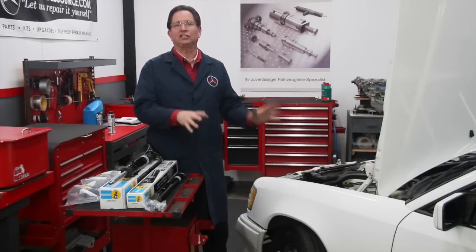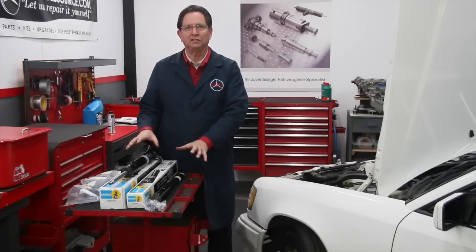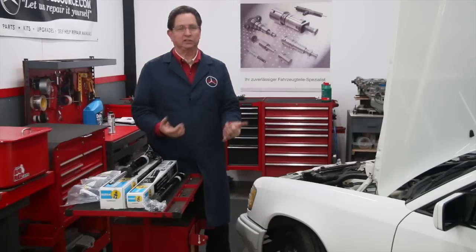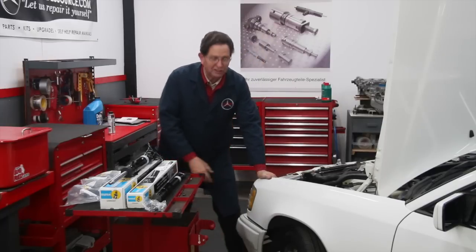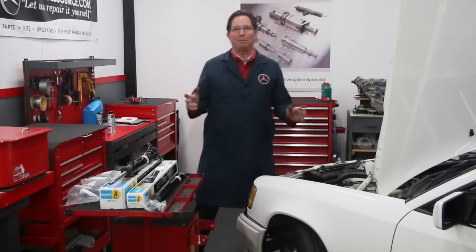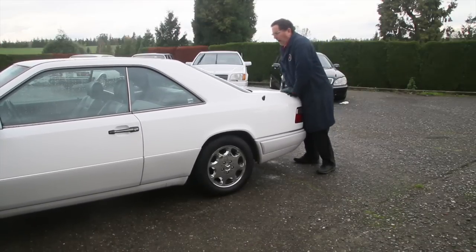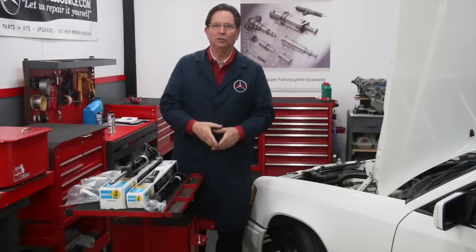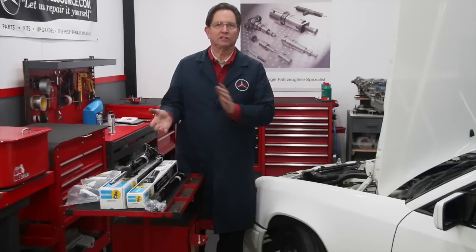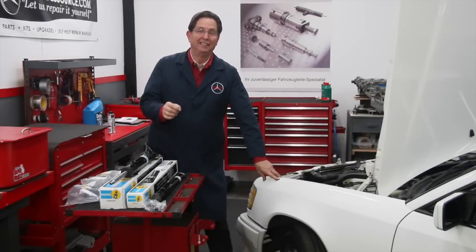That's a great example of the point I want to make. When you own the car and drive it consistently every day for years, the decline of your shock absorbers is gradual. Particularly with Bilsteins — they're gas-over-hydraulic, and you may start to lose some of the gas pressure but the hydraulics will still work. Sometimes a bounce test may not even work. But look at the bounce test on the front of this one — it's really bouncing up and down, and it's squeaking too. Mileage is a good indication, but it also depends on how and where you drive.